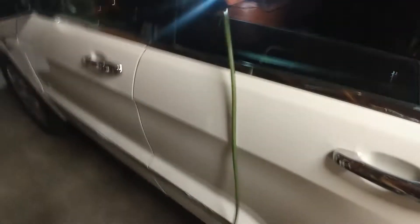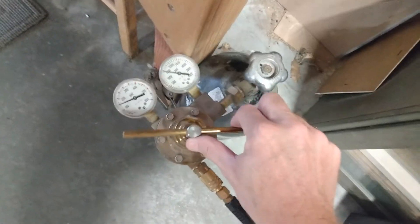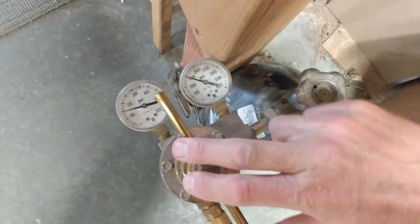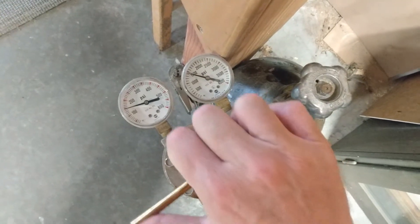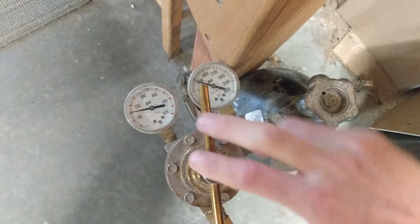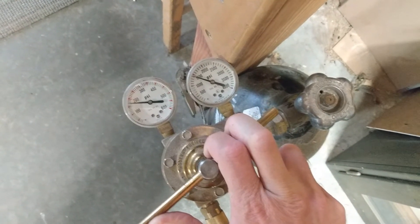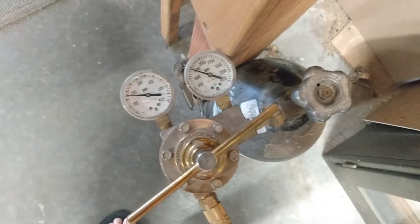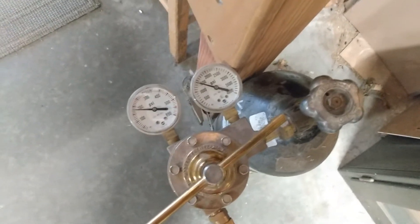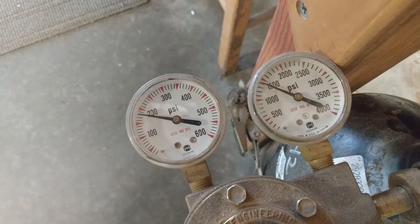We're going to close the door and start the engine. Engine is running, hose is hooked up, tank is turned on. Now I'm just going to turn the regulator in until we get to about 150 PSI — I'll go to about 175. We're watching the left-hand regulator, which is the low-pressure one. It was already at 150 because I didn't need a charge, but it doesn't hurt to overdo it a little bit. Your system will vent any overpressure — you can actually hear it doing that if you put too much in. I'm going to leave it at about 180 PSI. You can hear the gas coming through the hose, so it is charging a little bit.